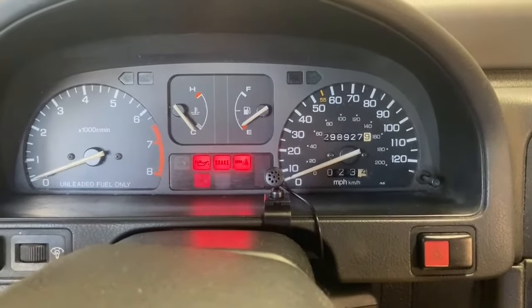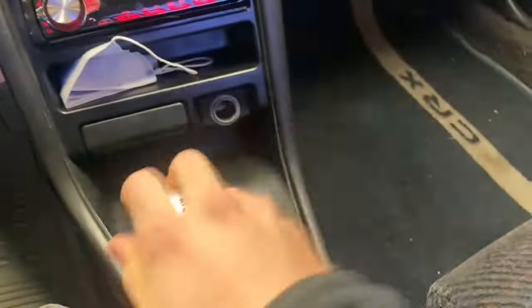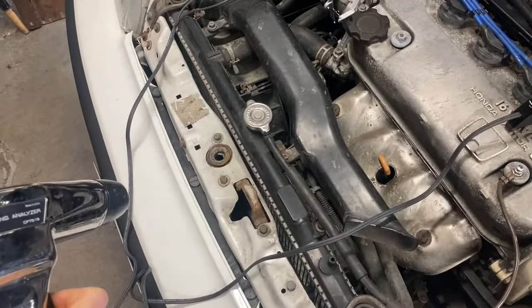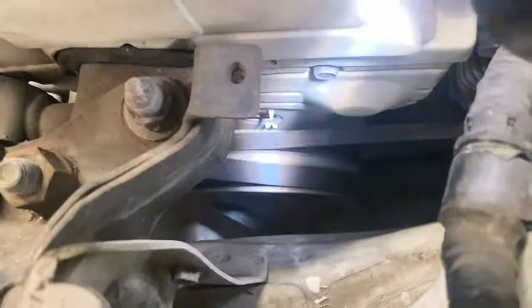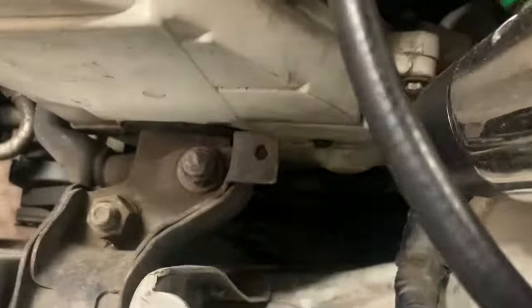Put on the clutch, get that fuel pump kick on, make sure it's in neutral, and I'm going to let go of that clutch. Alright, I know it's going to be hard to hear me so I'll try to speak up, but I'm going to try shining this light down in there. If you pull this trigger you can see that light kind of kicking on. You can see those three white lines are to the right, which means we need to tilt our distributor to get it to show up on there.